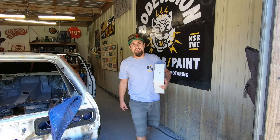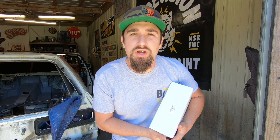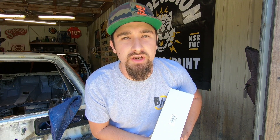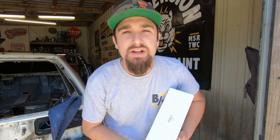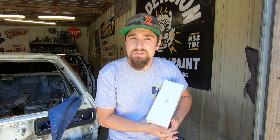As I'm doing this build — which is so one-off, I believe the only one in the world — there are a lot of questions about how I'm going to be monitoring everything. For example, the Tremec T56 speed sensor is an electric output, but my speedometer in the Accord is a mechanical speedometer. So how are we going to work electric output to mechanical input? And there are all of these questions.